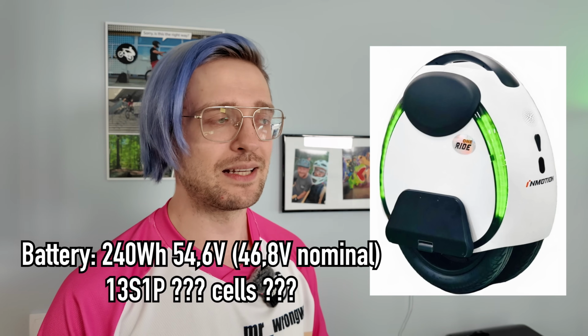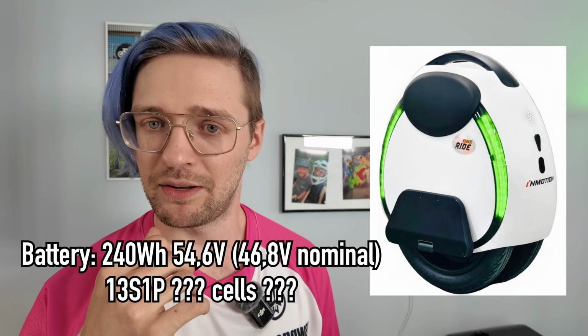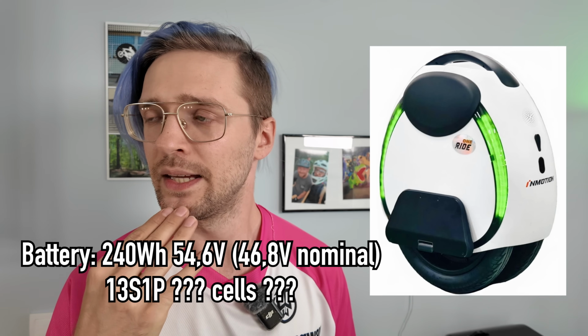The biggest downside for me is that it doesn't have a smart BMS, and I'm particularly adamant about it, not only because of my name, which is Adam, but because I bought a V5F back in the day, and I bought it used, and it failed on me like 3 or 4 times. Later, once I realized what the problem was, it turned out that it had to be the battery. The battery had issues, it wasn't balancing, I wouldn't know why it just turns off randomly, and if it had a smart BMS, I would find out about it, I would repair it, and then I would still have a wheel. And this is my main issue.